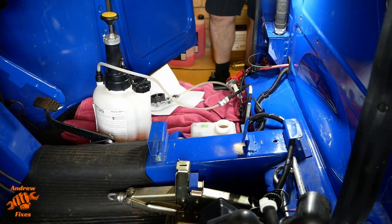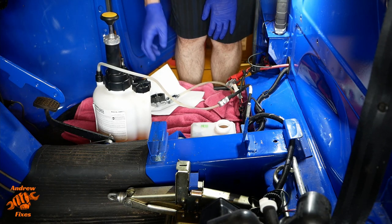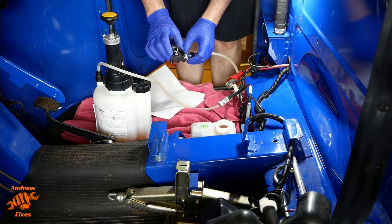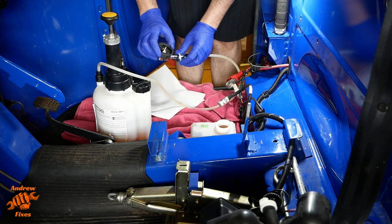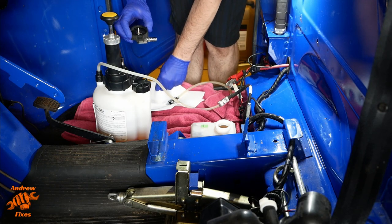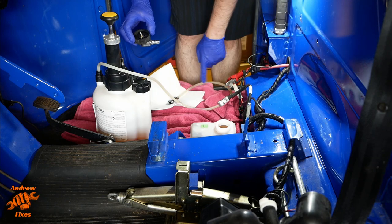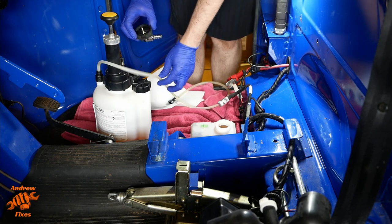Right, I've got my pressure bleeder ready now. So brake fluid in here, cap on there, pump here, and then a quick release here, with what turns out to be a pretty much universal cap for most systems, although on some of the Japanese ones where it's a bayonet style fitting that doesn't fit, so you've got some other options there. I've bled the line, so this line's full of fluid. You can probably see it's got a slight straw colour to it. That's the colour of fresh fluid.